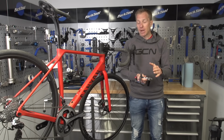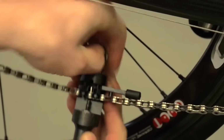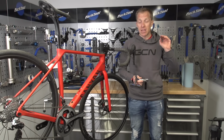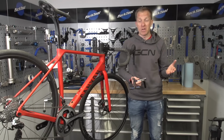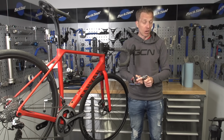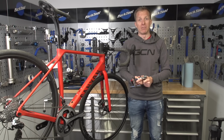What you buy really does obviously depend on your budget. However, Campagnolo actually recommend using one of their own chain tools if you're splitting and refitting one of their chains. Reason being, the pins on their chains actually require a lot more force to push out than other brands of chain. At home, I have used my own old chain tool, a non-Campagnolo one, to remove one, but basically stick with Campagnolo's advice, it is there for a reason.